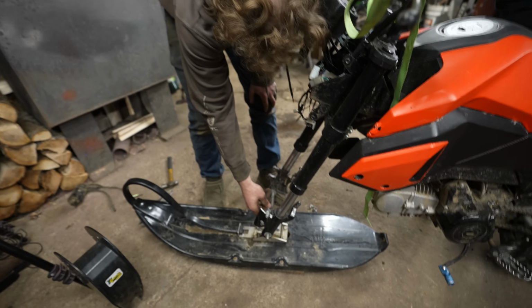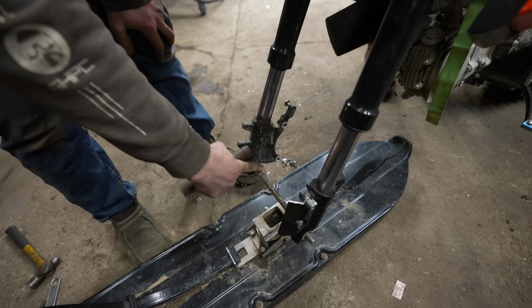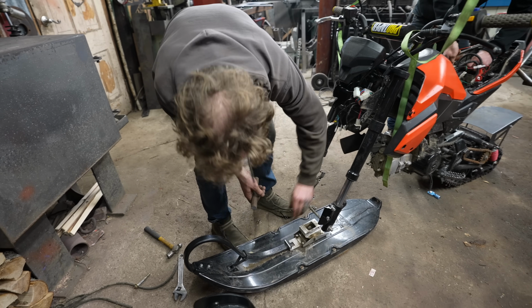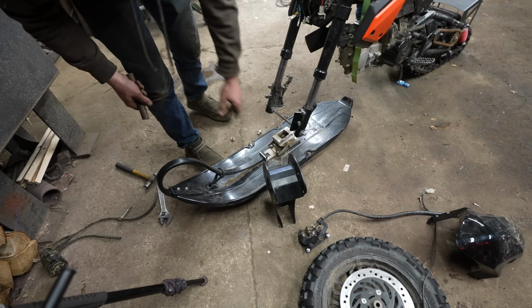A steel spindle it is. I'm gonna bore this out on the lathe so that it fits this bolt, which will reduce its weight significantly, and that'll be the basis for the spindle. Then I can make some uprights. I'll kind of model it after this to some extent. Obviously much smaller.